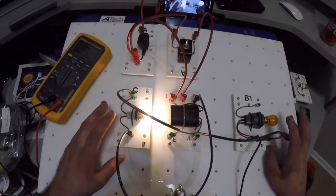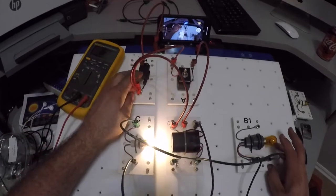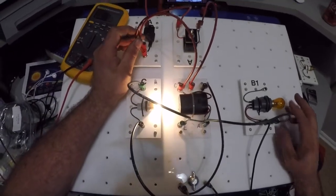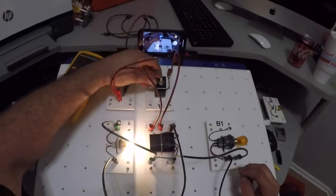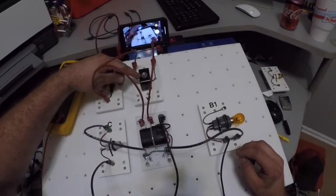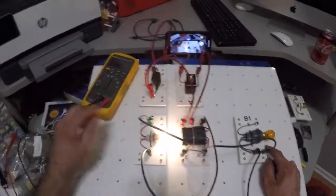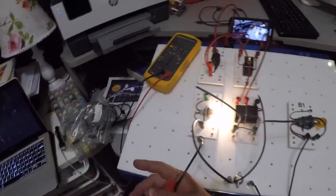But before we go and do everything, we know that my fuse is working. Power comes in through here, through my fuse, and out these two wires. One of them comes over here, and the other one goes through my switch. If I turn my switch on, why is my light not coming on? I know I have power here because my bulb's working, so I should have power here. So we're going to do voltage drops to verify why my power is not working on this one circuit.